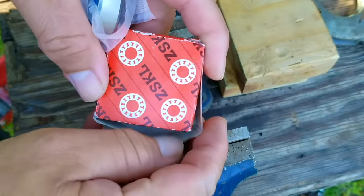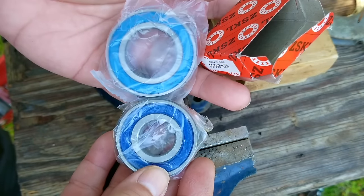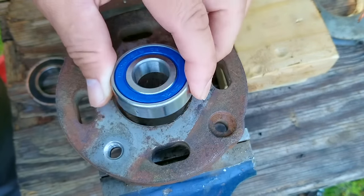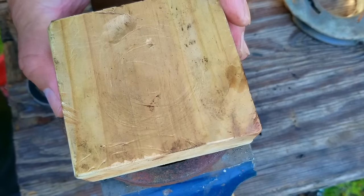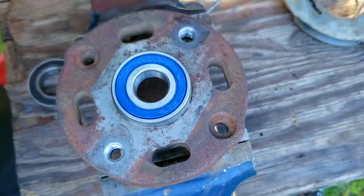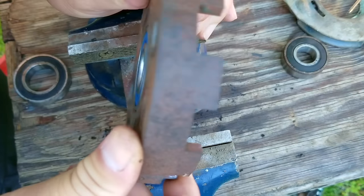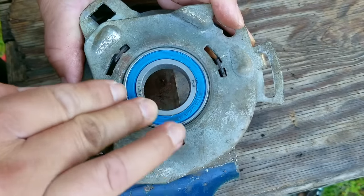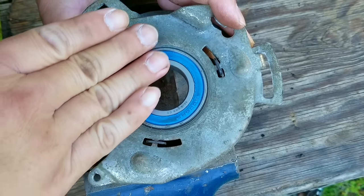It's now time to install the new bearings. These can be bought online for about $10 a piece — if you want the part numbers I'll put the links in the description so you can see if they'll work for your mower. I do apologize as I installed the bearings off camera because I needed a firm foundation to hit against, as this wood table was absorbing a lot of the force. I used a piece of soft wood as a buffer from the hammer blows and installed the bearings flush, just like the original ones. Installing the bearing on the plate assembly was a bit harder because it's not flat on the side I used the piece of wood on.